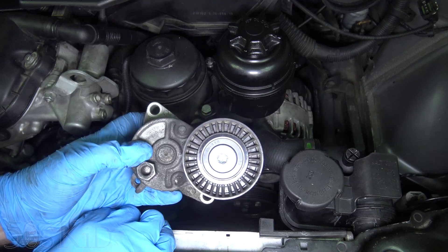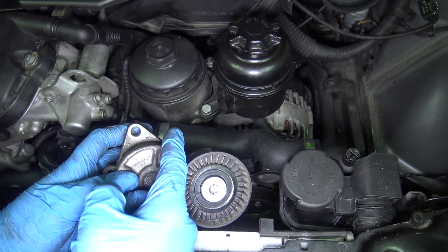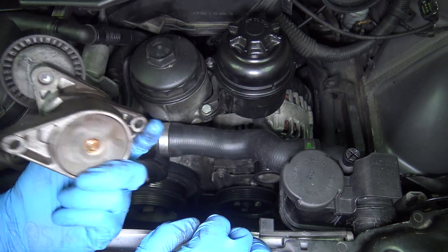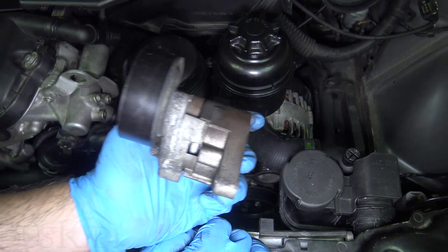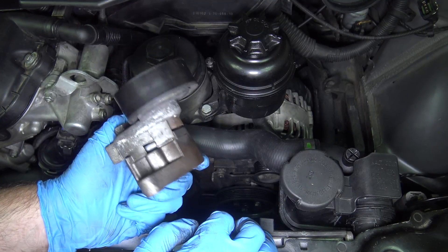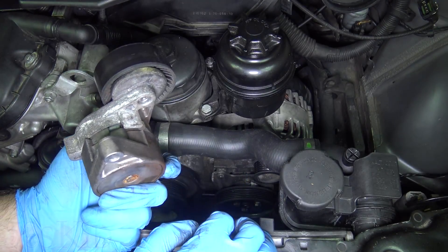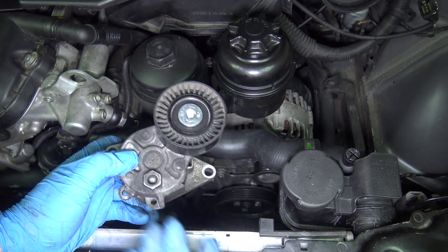I was in a junkyard and I looked at a car with a hydraulic tensioner — the dust seals on top looked like they were corroding because they're rubber. This manual tensioner is just a spring and that doesn't really corrode. It's probably galvanized metal and I think it has more longevity. But you can't keep this whole one — you've got to replace it anyway, and it's cheaper to replace this. That's kind of why I prefer it.